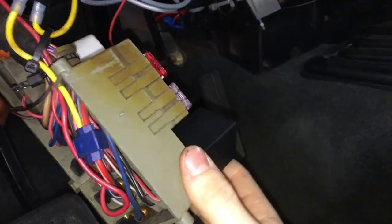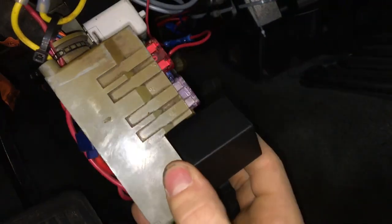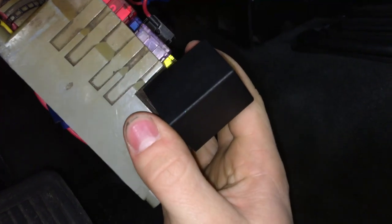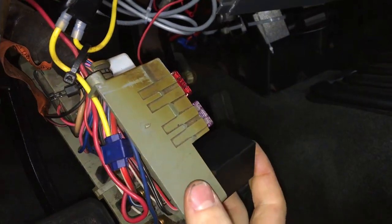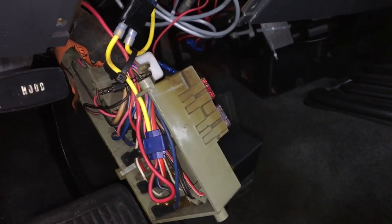I'm thinking I might have gotten the wrong polarity flasher. I'm going to do a quick test and change the wiring around to have one going to the different leg — these are two-prong flashers. I'll change the legs and see if that works, because they were selling two different types on that website. So I might have gotten the wrong kind — I'll test it and report back.